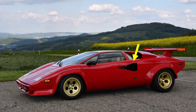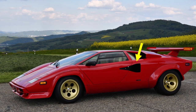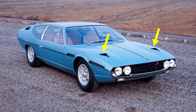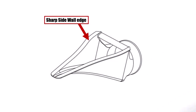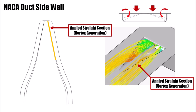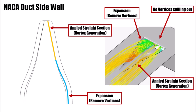The most characteristic feature of the NACA duct and its aerodynamic trick is its sidewall shape. The sidewalls could be just straight and we would have a simple intake. But what if we can generate side vortices that change the flow field and bring even more air into the intake? That's exactly what these sidewalls are doing, and what gives the NACA duct its characteristic triangular shape. To create clean vortices, it's important that these sidewalls have a sharp edge. They also need to be at a certain angle to the flow direction, so the air can roll over them and create a vortex. These are in-washing vortices and drag clean air from even higher regions into the duct. Once the vortices are fully built, there is an expansion area that draws them inside and into the corners to make space for a clean flow in the center.